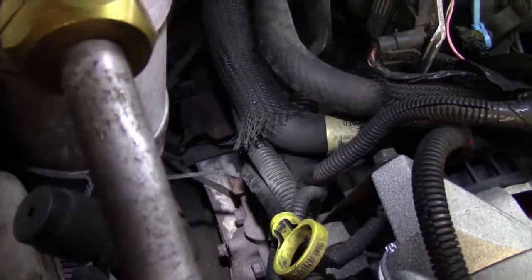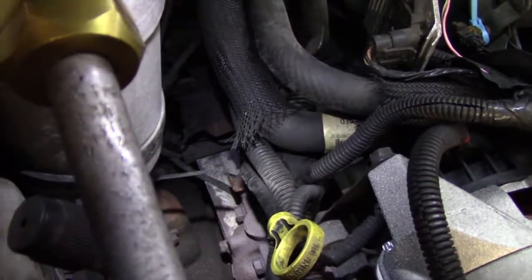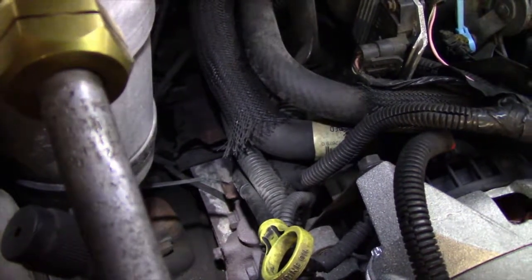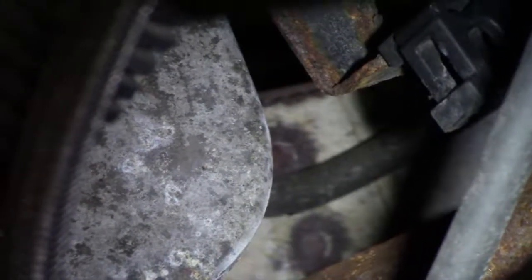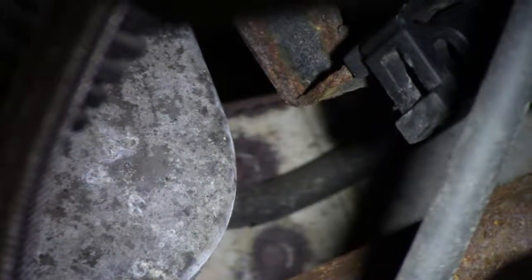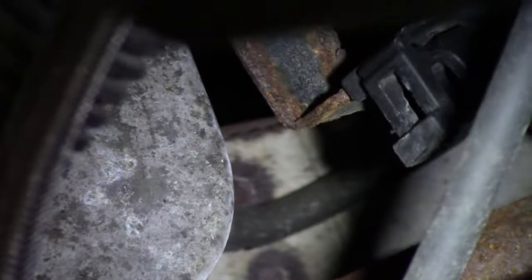It's kind of hard to show you, but you can see straight down there — there's a wire laying right across the heat shield for the exhaust manifold. That is one of the cylinders we're having a problem with. On the driver's side, here's another wire laying straight on the exhaust manifold, and you can see right by where it's factory riveted it looks like there's a crack.